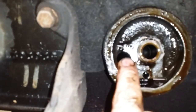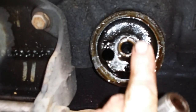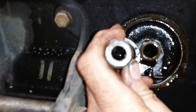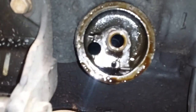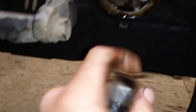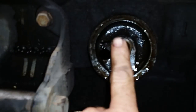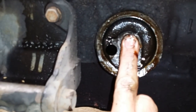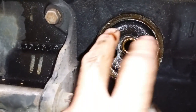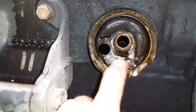The oil's coming out of here around the outside of the paper and then feeding back down through the center through a hole that big instead of a hole that big. So I would think if you don't need this, I'd get rid of it. There's no kind of bypass. It must be built into here or something, but most of your V8 Chevrolets and Fords back in the day had a bypass that screwed down in here. So if your oil filter pressure got too high, like you got it stopped up, it would let it bypass and go back straight through instead of blowing the filter.